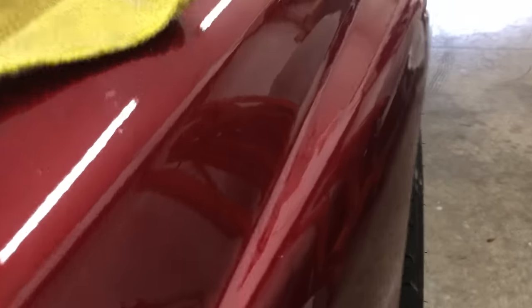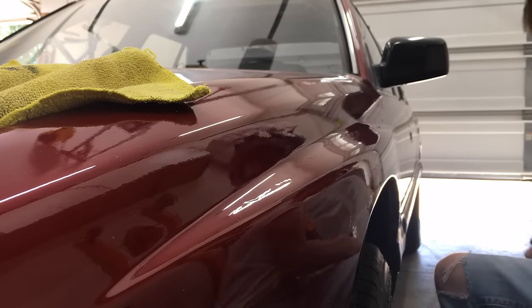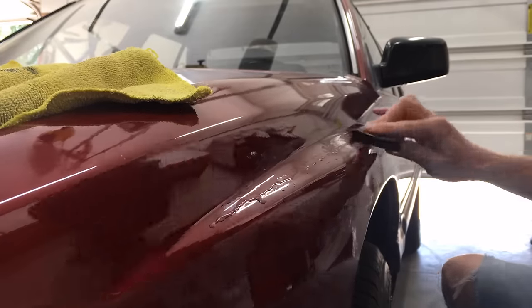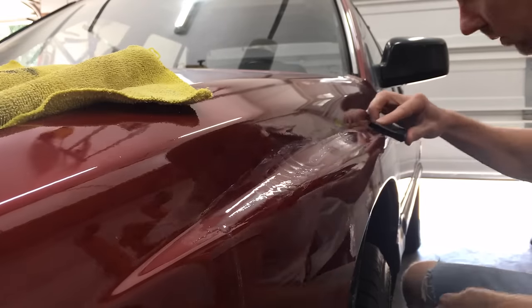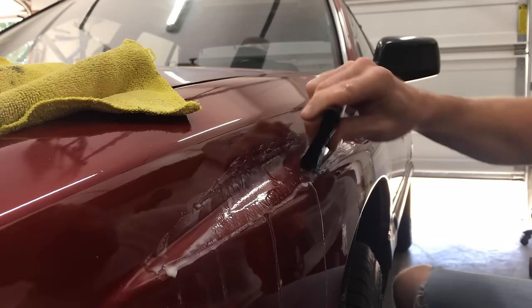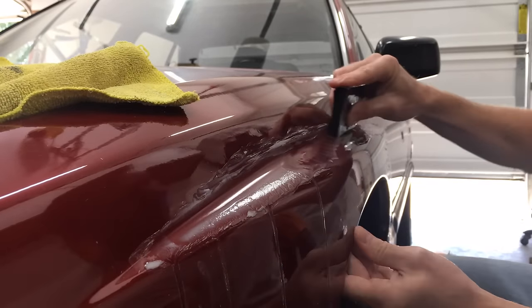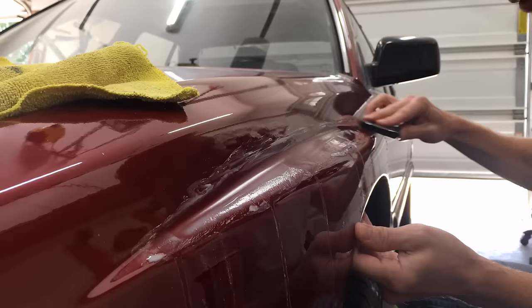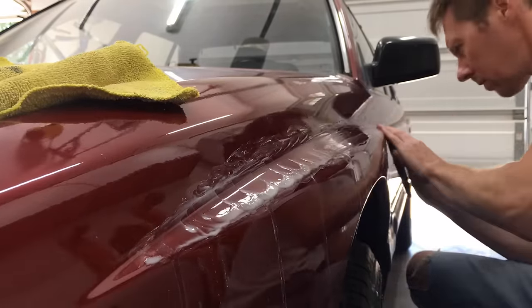You might recall this fender and the huge long run off the flare — it's really more like a giant sag. Because this was a thick heavy sag, it took many passes with the 1200 grit paper to get the surface smooth and even. I'm using the thicker, more dense sanding block here because the run is on a flat area of the fender. I'll put a link to this block in the description. Notice I'm using my fingers and flexing the block to keep most of the pressure on the run I want to knock down, instead of the outer edge of the fender that I want to be careful not to sand through.